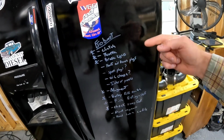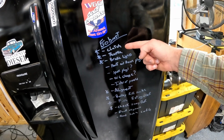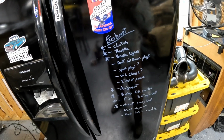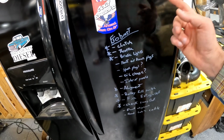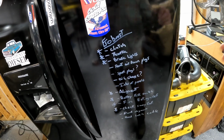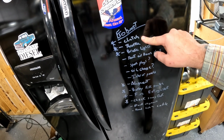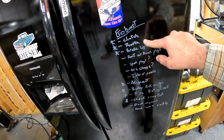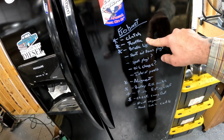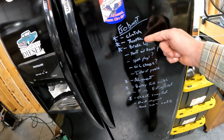But first thing we're going to do is the clutch. This thing kills my leg in like 30 minutes. It's just not fun to drive in traffic. The factory master is like a 0.81. I'm going to drop down to a low 7, 0.71 or something off to get the parts out here. So that'll make it a little bit more drivable. Currently the throttle sticks out like 6 inches, and my 6-foot tall frame puts my knee into the center console, and I need to fix that.